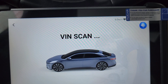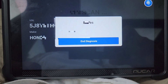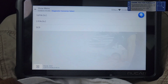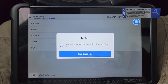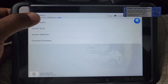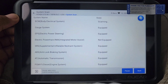Make sure your vehicle's ignition is on when scanning for codes or anything like that. It comes up as a Honda 2022. We're going to go to 16-pin USA since we're in the United States — it's going to retrieve the vehicle information. They have a health report that starts scanning, and a system scan where you can scan all the systems. Basically it does a full system scan.